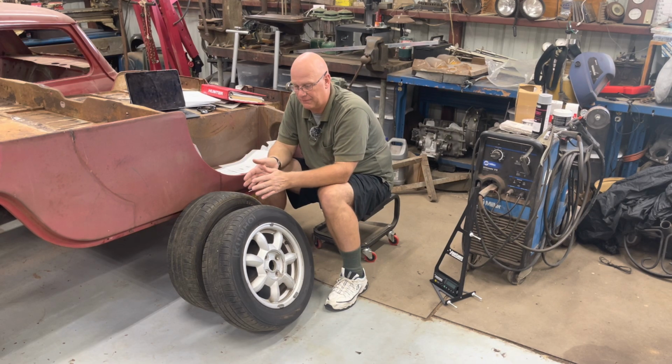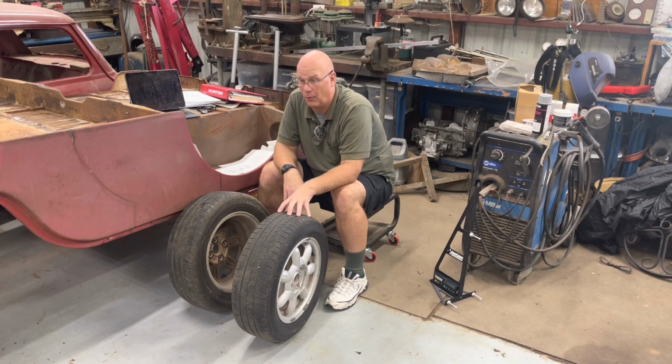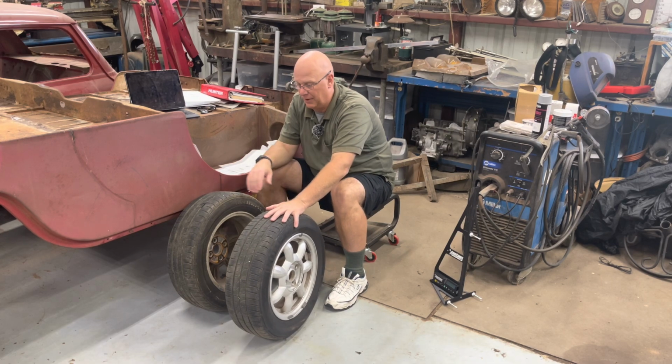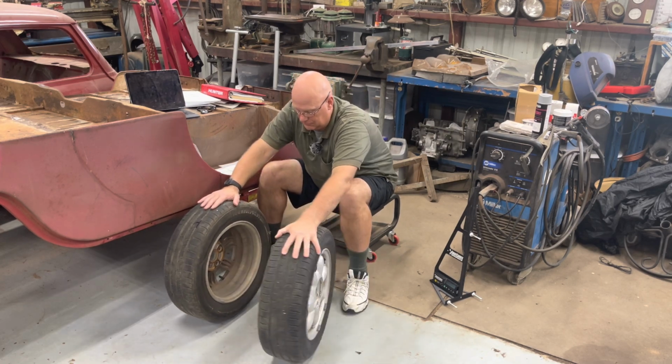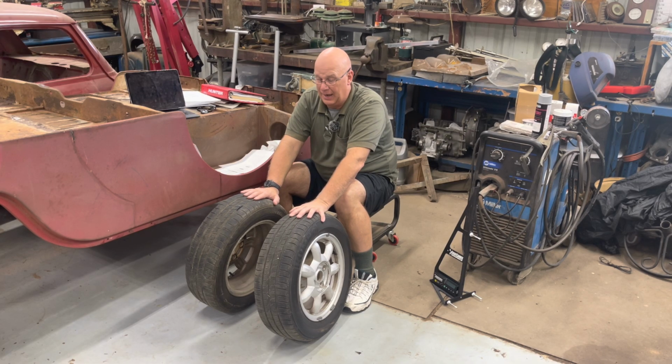Now, what is just right for you on your car? I loved the way my Porsche handled when I had a whole bunch of camber in the front, but I did not like at all that I went through a set of front tires in 9,300 miles. So I had a bunch of negative camber, and I got new tires. The tires have a higher wear rating, so that should help a lot by itself.